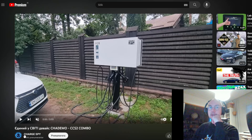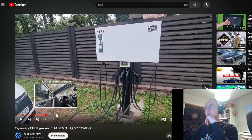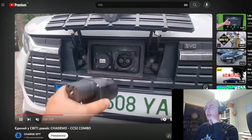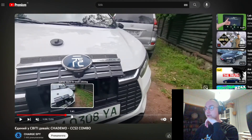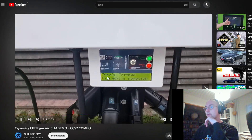It's by a company called ChargeSpy, and what they have here is a normal CCS charger and then they have a vehicle. This vehicle is quite special — it has a GBT socket on the left and then it also has a CHAdeMO on the right. What they do in this video is plug an adapter into the vehicle, and the adapter looks something like this — a very, very small adapter. The idea is then that you plug in your CCS handle directly into this. It's plugged in and charging, and everything looks good.